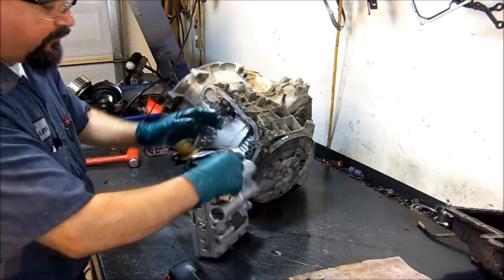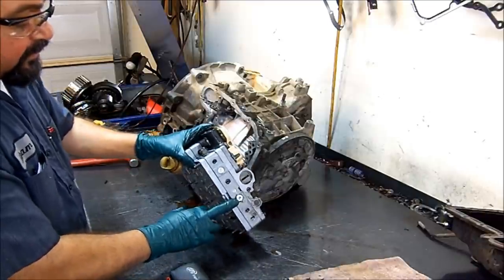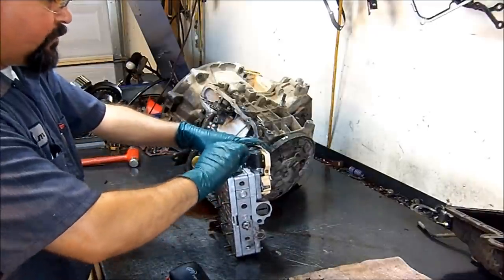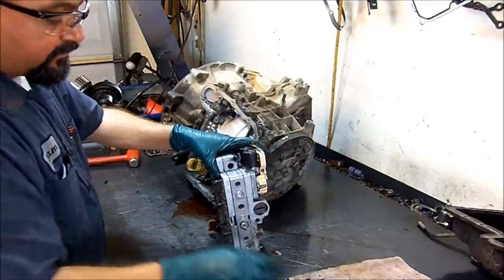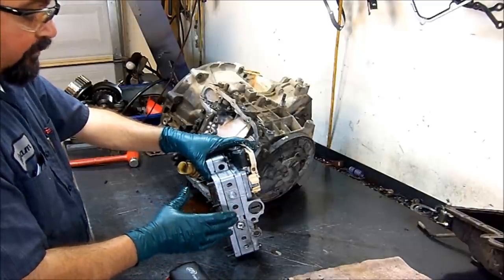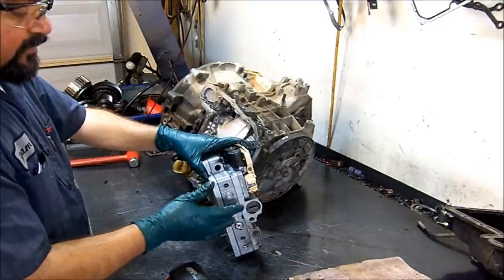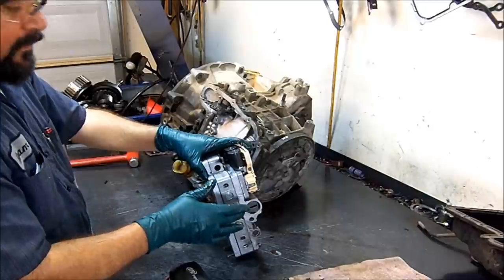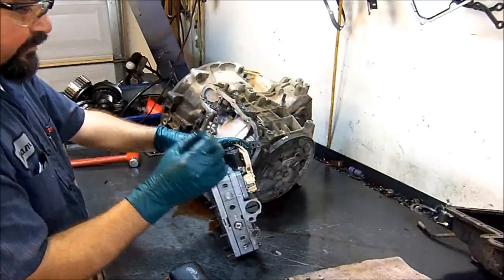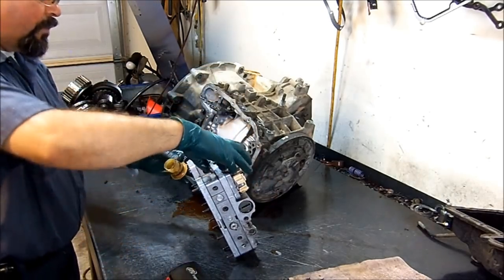Now, like I say, this valve body has been done before, and it has a Transgo correction kit, and you will identify it by this. This is a pressure relief valve, and the reason you want a Transgo shift kit on this one, Sonnax items are very expensive, and the Transgo kit works very well in these valve bodies. The original problem with this valve body is the pressure regulator valve will wear, and you would have a torque converter clutch with line pressure crossed in, extremely high line pressure, and it would explode the forward and direct drum.